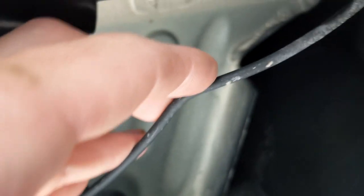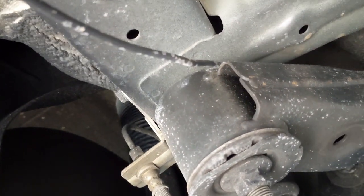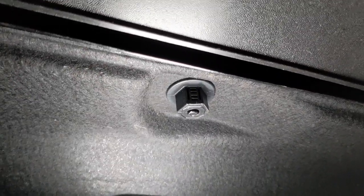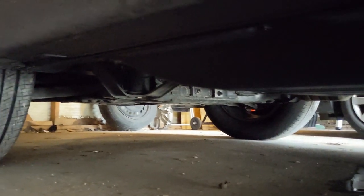There is a connector on the wire that goes all the way to the front of the car. You might need to extend it with a longer wire depending on your kit. The wire runs up over the rear control arm, and then in the middle of the car there is a plastic cover with some little fasteners. When you remove those fasteners you can take the cover off slightly and run the cable on top of it so that it is protected.